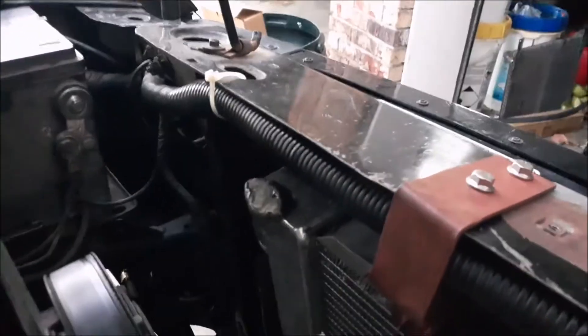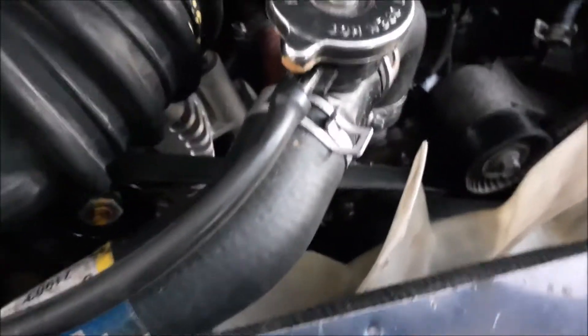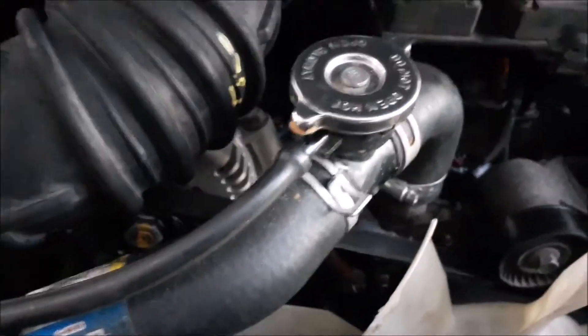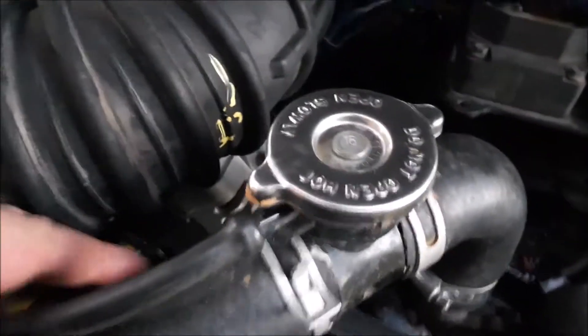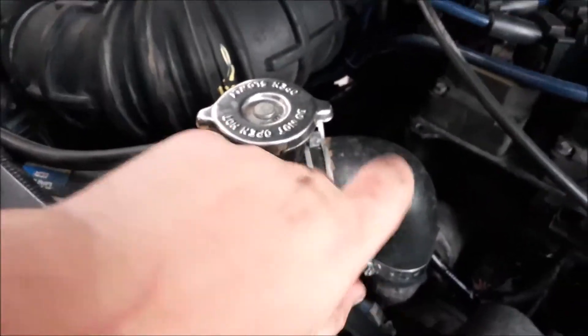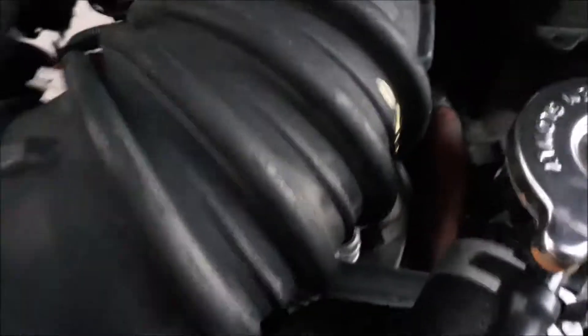With that I also ran into the problem that when I moved the radiator forward, I wouldn't have enough room to put the fill neck in, and it wouldn't bleed properly because it wasn't at the high point. So I took a part from a '98 Dodge Durango — one of their trucks — and they sold it new for about $15. It spliced in perfectly with the stock hose, so that was an easy fix.